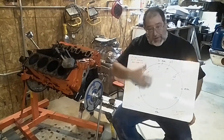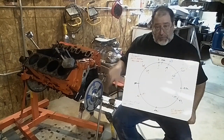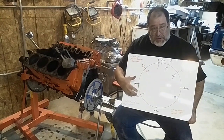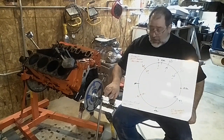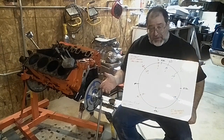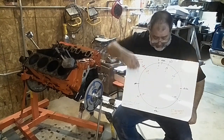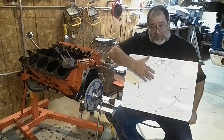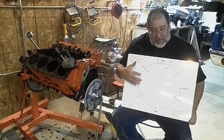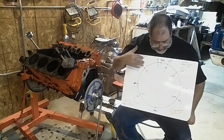This is how you look at a cam at the end of the camshaft. Remember, a crankshaft goes around for two turns. Camshafts are actually measured in crankshaft degrees. So because you have two turns, you have two times 360, or 720 degrees in a camshaft. This is like looking at the end of the camshaft as opposed to looking at the end of the crank.